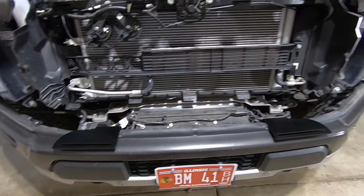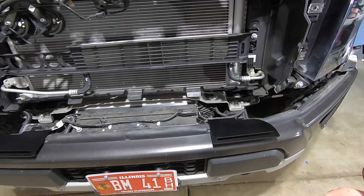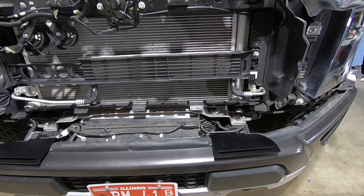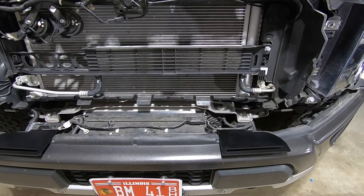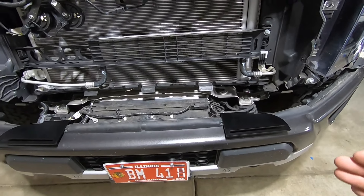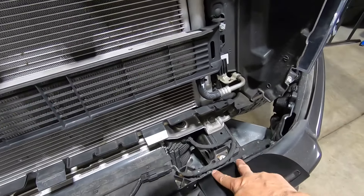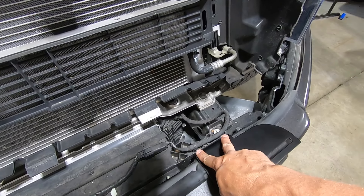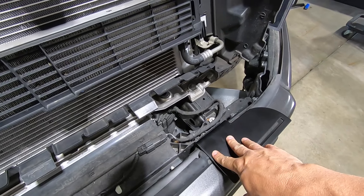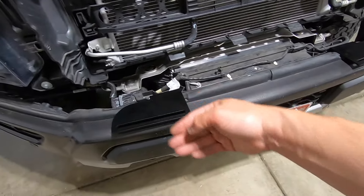Our brackets are completely installed and I'm very impressed. Originally when I looked at these I was like, are they going to stick out past the bumper? We didn't really see any pictures — Adam at 4x4 Truck LEDs just said hey, we have these brackets coming out — so I didn't know what to expect. But they sit dang near flush with the front of the bumper. The way I installed them is: loosen up those two 13-millimeter bolts in the back of the bumper, slip the bracket down as far as it will go, and then tighten those back up.